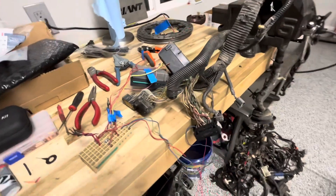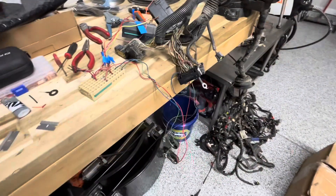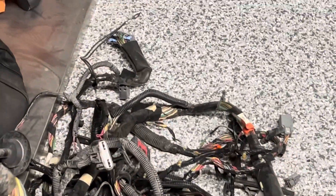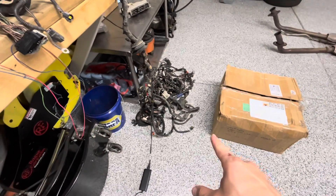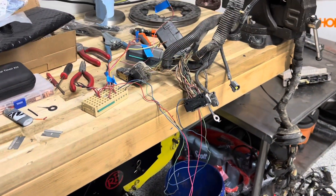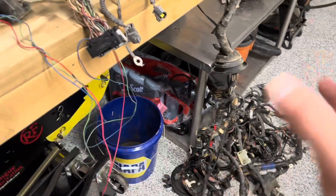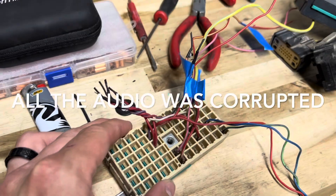It's time to get all the wiring done that isn't just repinning. I'll need to make a breakout harness for the MAF, redo the pedal harness somewhere in that mess, and wire the low pressure AC switch in series. That's going to involve a jumper back to the smart junction box — I'll do it the same way as I did on my own car. And of course, I'll also do the transmission harness.